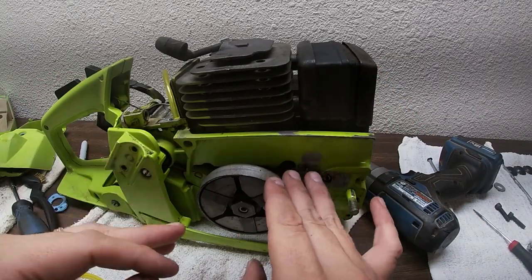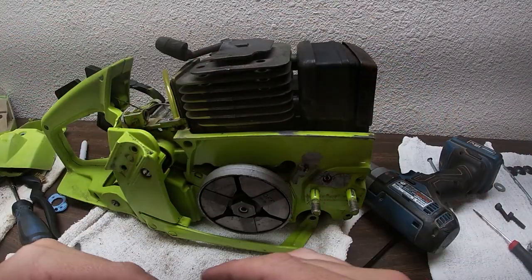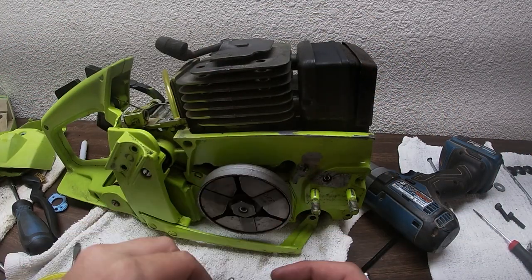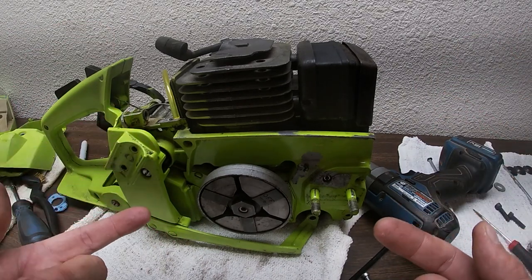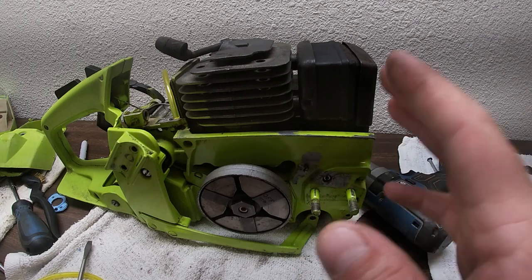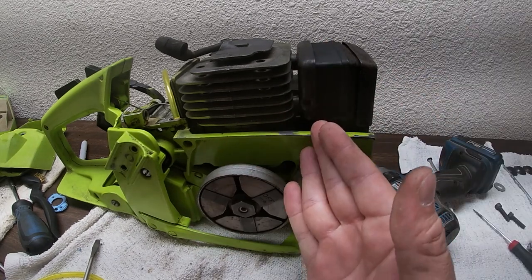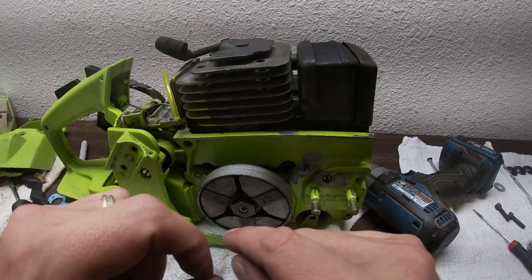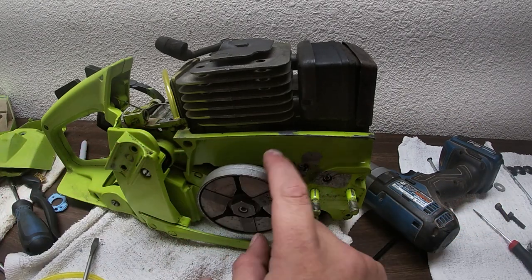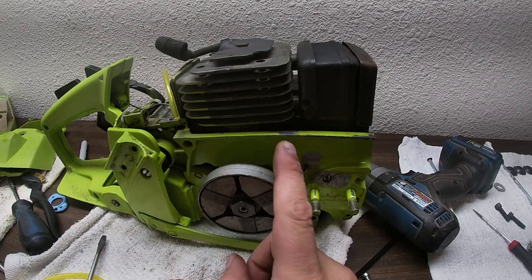Okay, so that's about all the hard parts done. So now I'm going to finally fully just put together the saw, add a spark plug, and we're going to take it out, cut some wood, make sure everything's running fine. So with the magic of editing, again, next time you see the saw, it should be done. I'm also going to use a 50-to-1 mix, zero ethanol gas. It's that pre-made can you can buy at Home Depot. So without further ado,